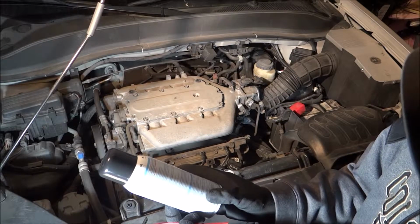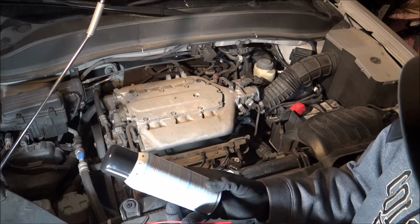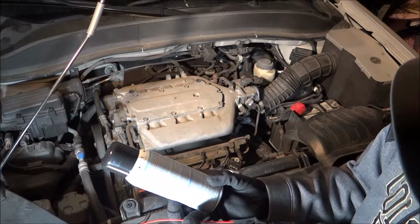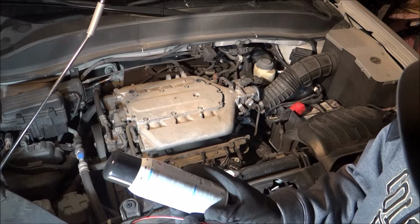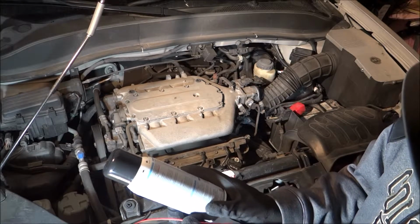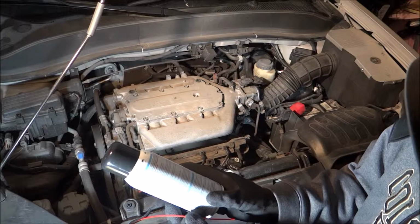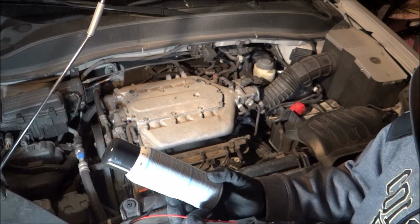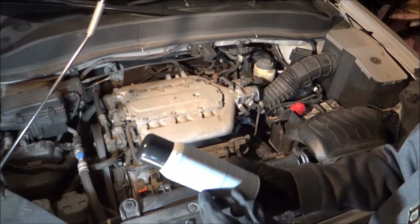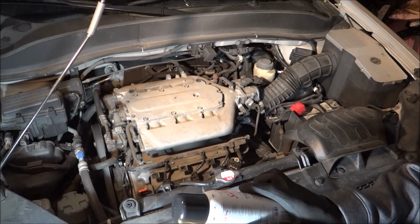After the entire can of SeaFoam spray has been used, stop spray, return to normal idle speed, and shut off engine. Remove cleaning tube from throttle body and reattach air inlet boot to throttle body and tighten clamp. Let vehicle hot soak for 5 to 15 minutes, then restart in a ventilated area as exhaust may be extreme for a short time. Road test driving aggressively to remove any remaining deposit buildup. All right, so it seems like they say a lot for not that many steps in the process.